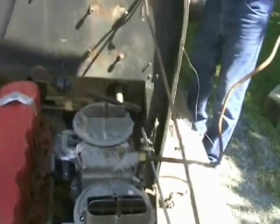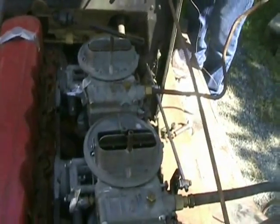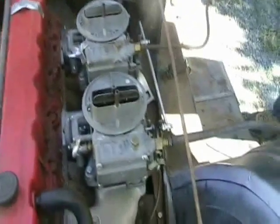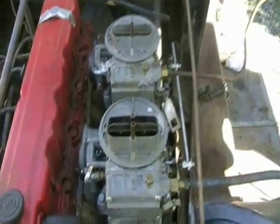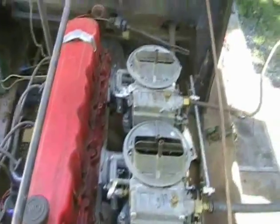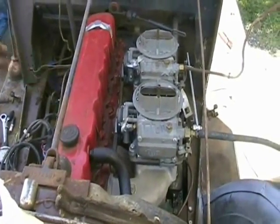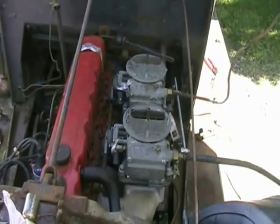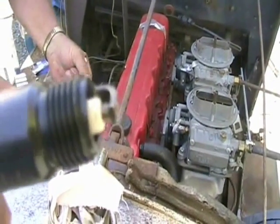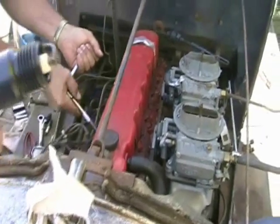Just fired — right there! You know, it's real weak fire. Those plugs, points, and rotors wouldn't hurt a thing. It's real weak — when I looked at that spark plug it's just a tiny little red fire. It needs to be a hot blue flame. Bob and I were just talking about how you should always check your plugs, because even though they're supposed to be preset, they're sometimes not. I just took that right out of the box and it's completely shut — no gap whatsoever. That's why we're gapping and checking them all before we put them in. You just can't trust nobody anymore, not even NAPA.